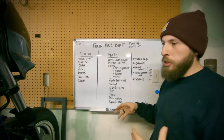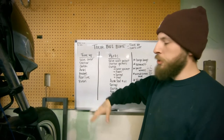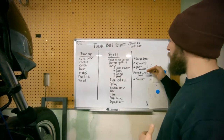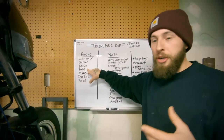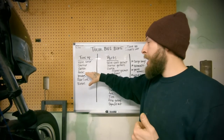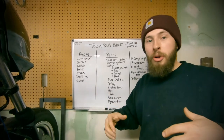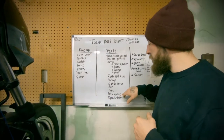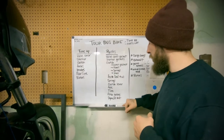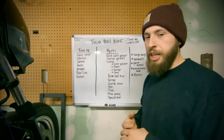Over on the extras list is actually painting the wheels — something I wanted to do last year anyway, so I'm just going to go ahead and get it done. We're going to be doing the brakes and we've got to do the forks, so we'll kind of have things apart anyway. I don't know if anybody has ever used aftermarket springs in their forks on their CB700 or just in general, but there's actually two different brands: Racetech and Progressive. The Progressive ones are a little bit cheaper, so I was thinking of going with the Racetech. If you've ever used those, comment below and let me know how they worked out. We also added a couple things to the list — fork gaiters, which we'll use when we put everything back together, and also a Dyno Jet Kit, because I modified the air box last year so it definitely needs a bump up on the jets to help it run a little bit better.